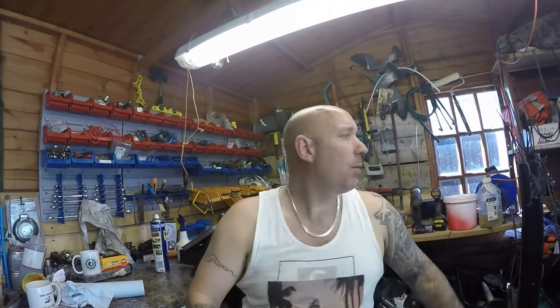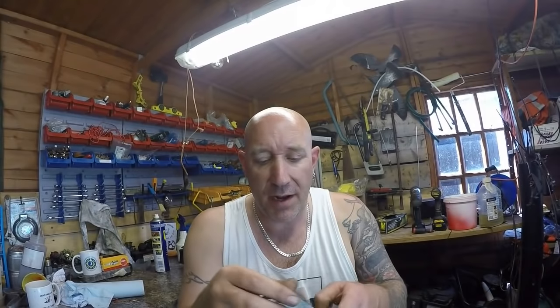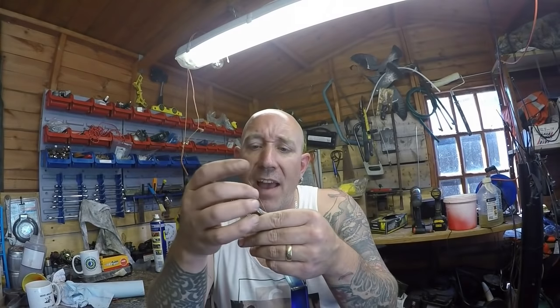So as you saw, I had no faith in myself at the time. I had a feeling it wasn't going to happen, but I think I know what the problem was, and it was purely just the little tiny jet that sits on top of a tube. I could see daylight through it, but when I pushed my little tiny files through, here they are, this little tiny file set, it doesn't take any material off, so to speak. They have got teeth on them, but they're not really a file, but they do clean very well. And I think it nearly doubled the amount of gap in there. It wasn't drilled out, it's just literally cleaned properly. And I think pretty much that was all it was.